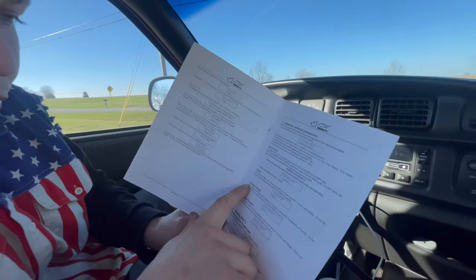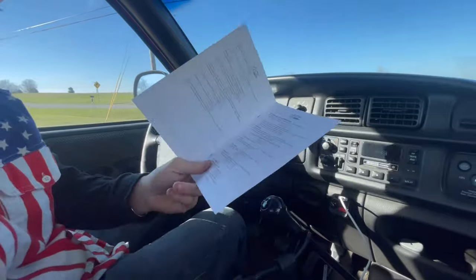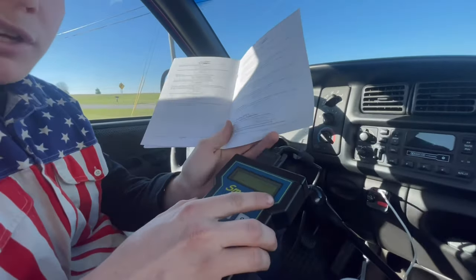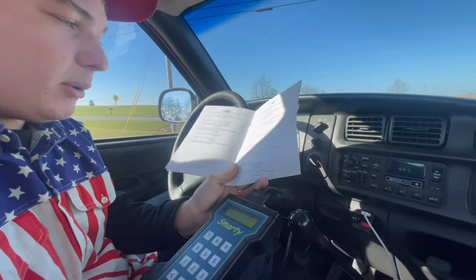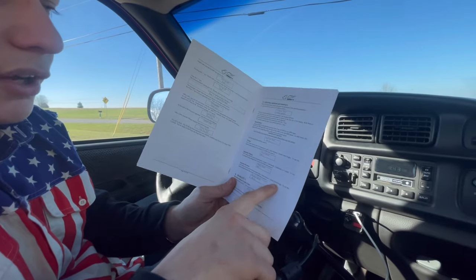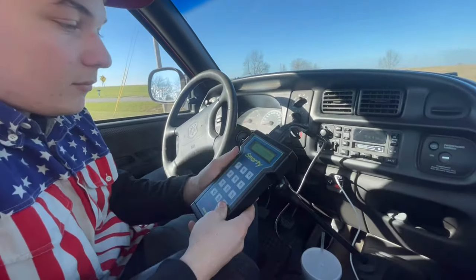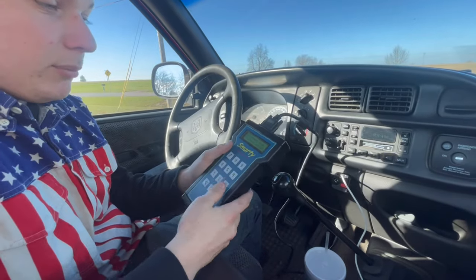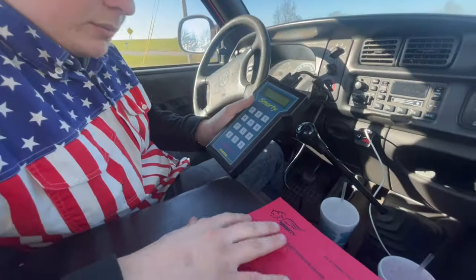You come here to injection timing. You can go from 1 all the way up to 4. But of course, I ain't played with any of that. I really couldn't tell much of a difference from just putting it on a tune off this paper. Then you go down to injection duration. You can go as little as 1 stock and 5 for high. And that's right here, and then you save your memory. We didn't change nothing. Now let's get to the fun part of playing with tunes.